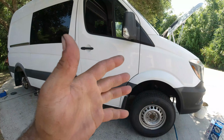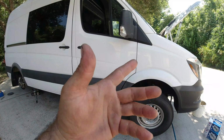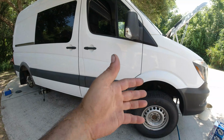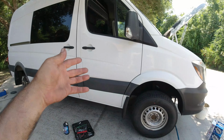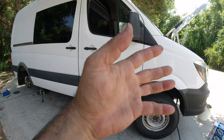Alright guys, this video was how to diagnose and replace your calipers on 4 tires. In my case, only the 2 fronts were bad, but in this case, change them all at 100,000 miles. That way you have them new for probably another 100. And also, drain the lines, get new fluid in. As you saw, the color was dark. Brand new fluid has a lighter color.